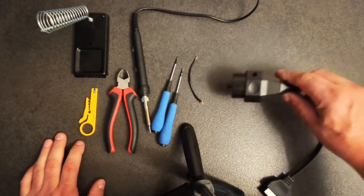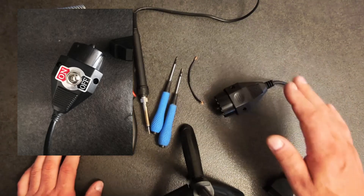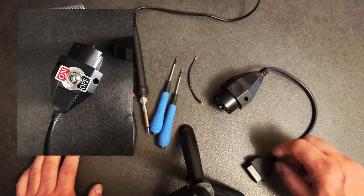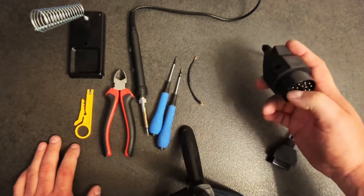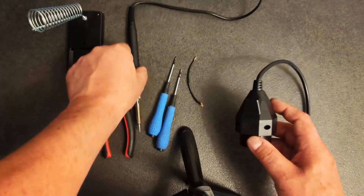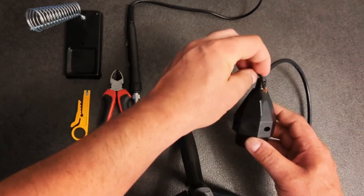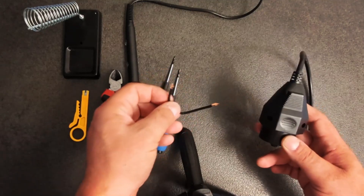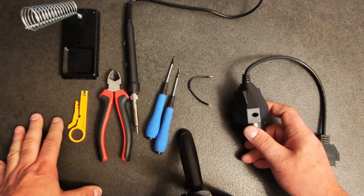I had an adapter I'd been using with a jumper switch for a while, but unfortunately it broke — the connection comes and goes and I couldn't locate where the break in the wire is. So I ordered a new one; these are like 10 bucks online, pretty cheap. Now I'm going to open it up and solder a bridge in there to permanently apply programming voltage to the ECU when connected. A switch is not actually necessary — on some forums it says you need the switch only for the programming voltage.